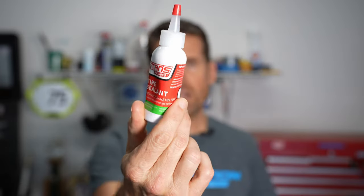The second reason is that you're adding weight. Tubes don't look very heavy, but this trail bike tube has some heft to it. Tubes made for mountain biking can be pretty heavy, and you're adding rotational weight, which is where weight makes the biggest difference. Static weight like a water bottle doesn't affect ride quality as much as weight in the wheels, because that weight is further from the center and makes the bike accelerate slower and feel heavier. Without the tube, the bike handles quicker and feels lighter.